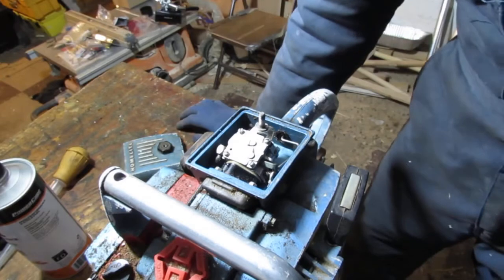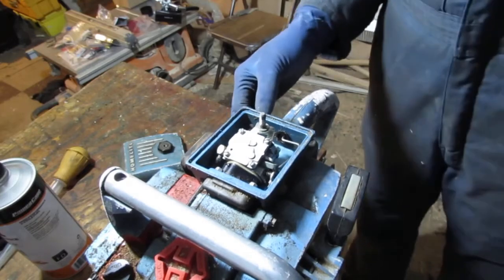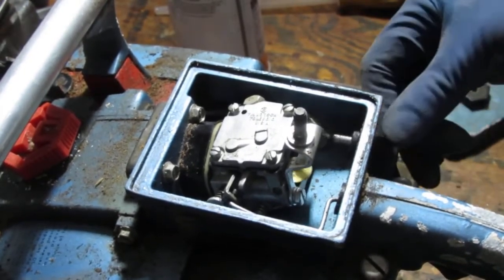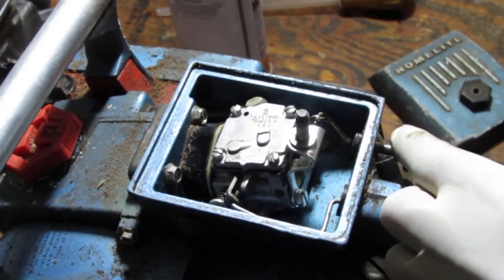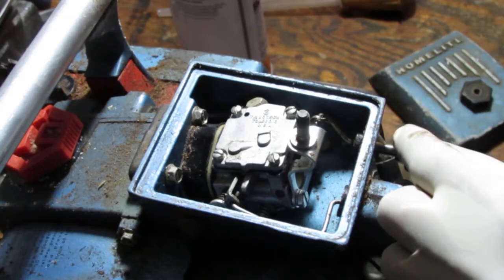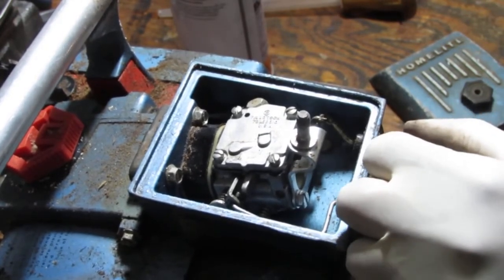All right, and that's a cool little carburetor. Okay, there's a choke. See that? Probably can't. So here's our choke. Pull on that. That opens and closes the butterfly. This carburetor is neat. It's made in America? Wow. The company's Tillotson? Hold zero? Is that an O? I don't know. Some of you may be more familiar with it, but I'm not.